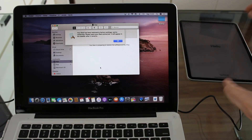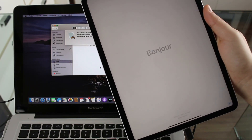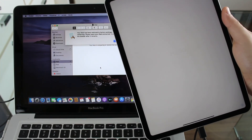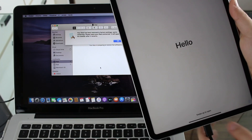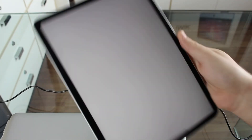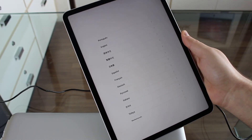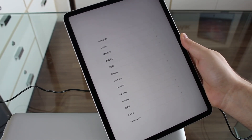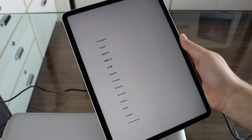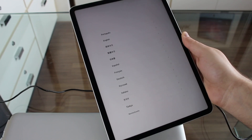Just like that, we're done. Our iPad has automatically restarted and we are seeing the welcome screen — the setup screen saying hello in various different languages. Now all you have to do is normally set it up. You can unplug from the computer and close iTunes. Just go ahead and set it up: put your language, put your Apple ID. Here's the important part — if you have a backup, go ahead and recover from the backup so you don't lose any information. And your old passcode is gone. You have successfully removed a forgotten passcode from your new iPad Pro without a home button.